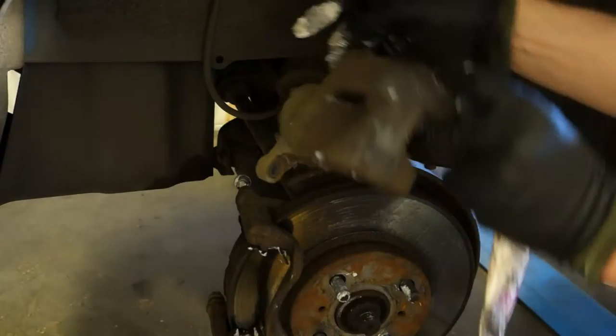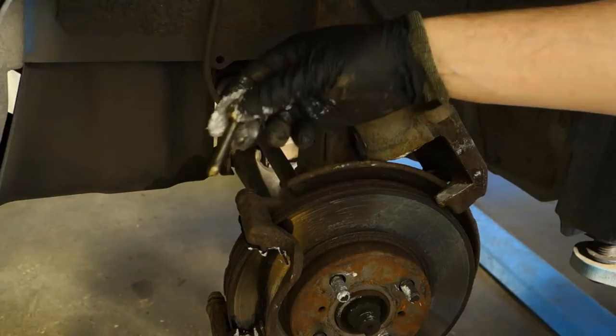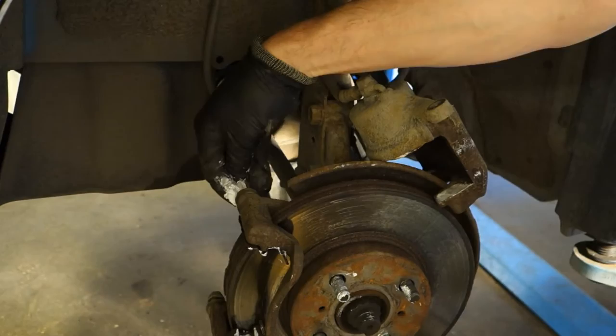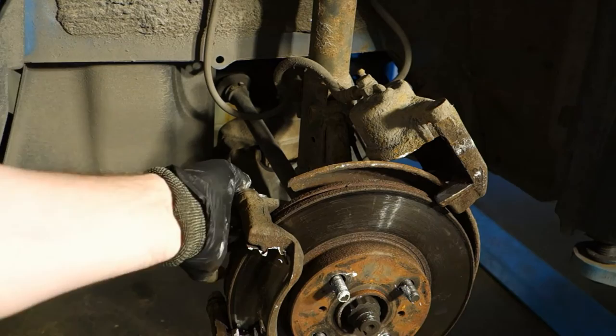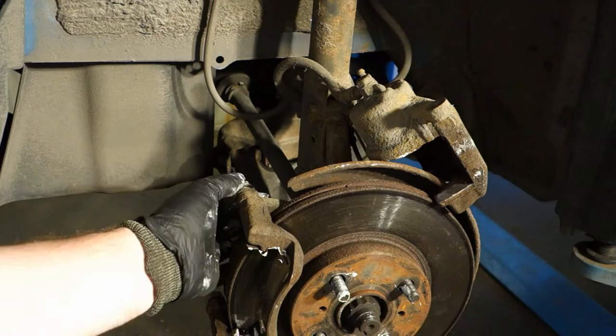And the final step is, if we have movable joint bolts like in that car, we can lubricate these also, because all moving parts need lubrication. Now I used only one brake lubricant, but there are even more specific, slightly better greases for some specific points, like the rubber area, but this metal-free paste is better than nothing. The idea is that all parts move. Movement is the key, and the best way to check is to move them with our fingers, and if they move nicely, everything is okay. If you notice that some part is stuck, then you need to take it out and lubricate.